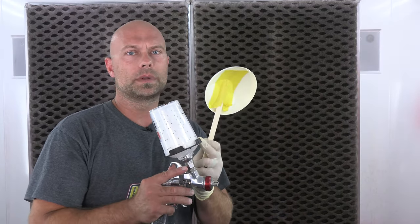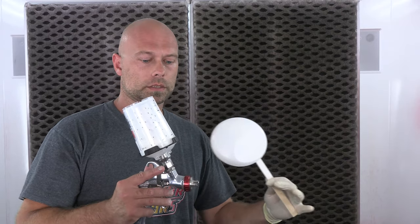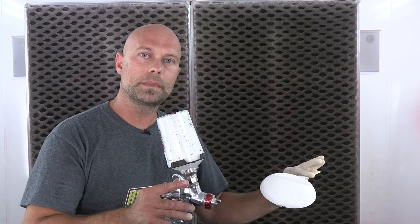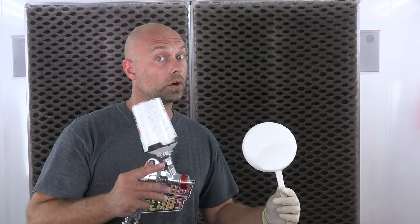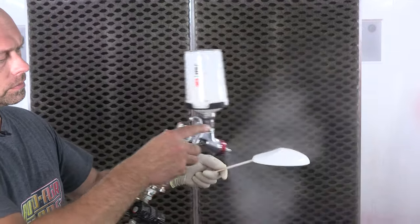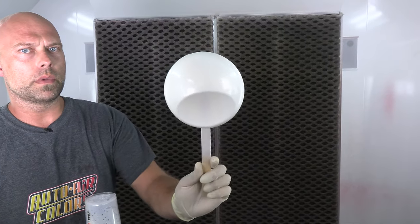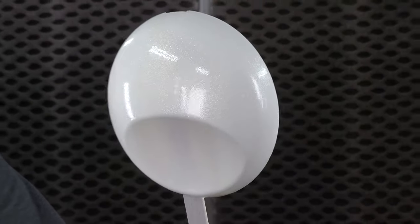What I went ahead and did was mix our metallic white with our UVLS gloss, our 4050. That's a very universal product for us. I mixed that 25% with this metallic white, so it's going to help with the orientation of that metallic, with sprayability, dry, and everything — it's going to lay down really nice and smooth, which is exactly what we want. About four coats, you can actually over-apply this and it's going to look that much better. You can see the amount of metallic, that glitter in there, and that's only going to get more intense the more you apply.